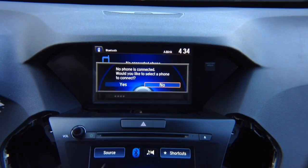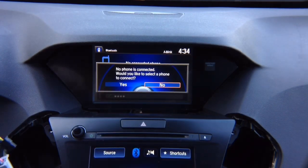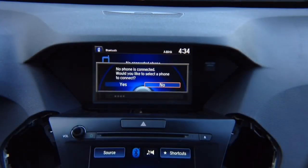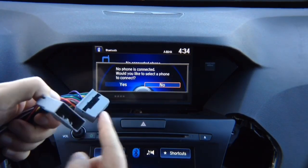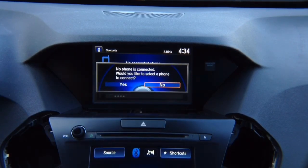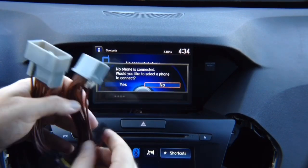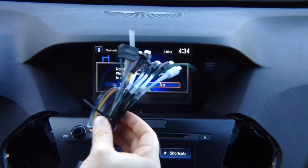You've also got a harness that allows you to control Apple CarPlay, Android Auto, or the interface with the factory joystick. The factory joystick connector is found at the back of the radio — unplug it, plug it in here, and then this connector goes back into the radio, with a T-off that connects to the main harness. You've also got a power connector — find the matching connector at the back of the radio, plug it in, and this goes back into the radio. The T-off connects to the main harness. The main harness has four camera inputs.